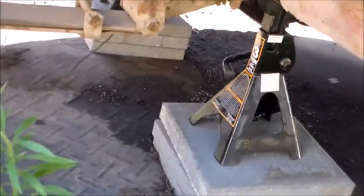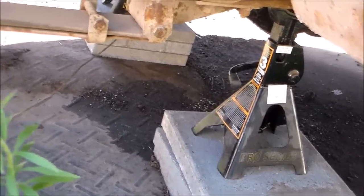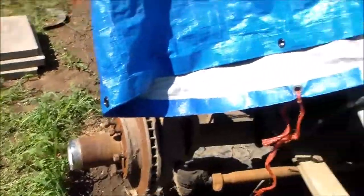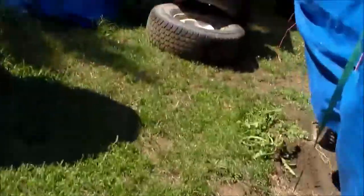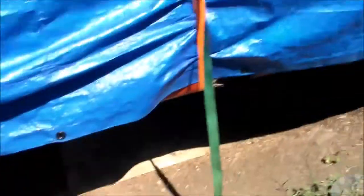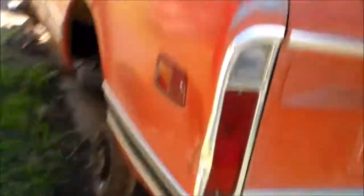That's the way I planned on doing it. I wasn't going to use cinder blocks — I've seen the carnage that has caused. Now I've got a better view of what all I've got to do. Next step, if I get the chance, I'm going to yank the axles out, get those out of the way, and place them someplace. Yank these apart, go through the seals, get them serviced and taken care of. At least like this I'm not having to constantly deal with the tires. That was the main goal — get it up off the ground to where I can just start yanking everything out.